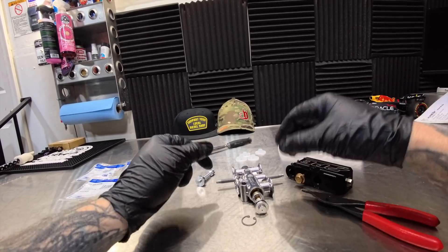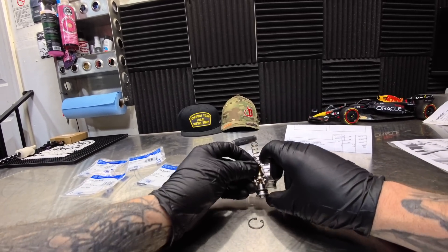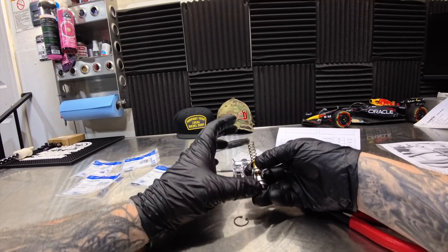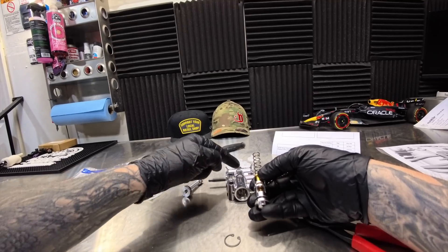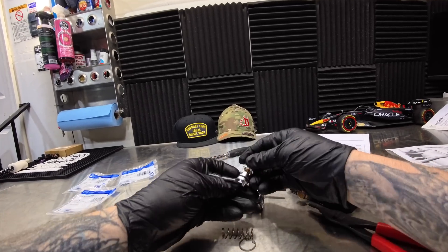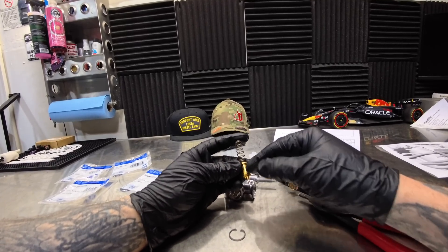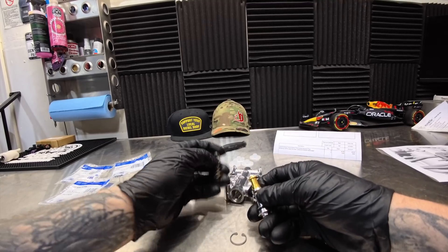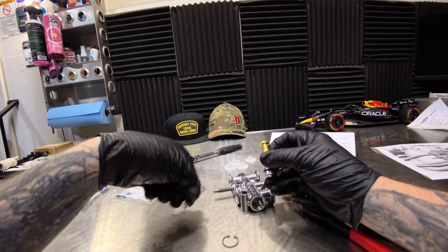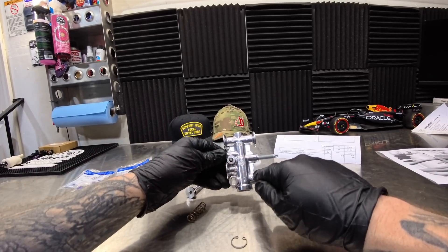Obviously I don't want to do this on the truck because there's a crossmember in the way, but this is located on the right side of the engine for my 3.0 Duramax diesel. Now you can see the valve assembly here — this is just a traditional wax pellet style thermostat. This spring is pushing down on here and that's allowing the fluid to go back up through here, which routes it back into the transmission. As the temperature increases, this pin will actually stick out further because the wax pellet inside is pushing it outward, and what that does is push the valve up so it seals right there. It'll fight against the spring and push up, so now the fluid is no longer routed back — it's actually able to go through to the cooler at that point.